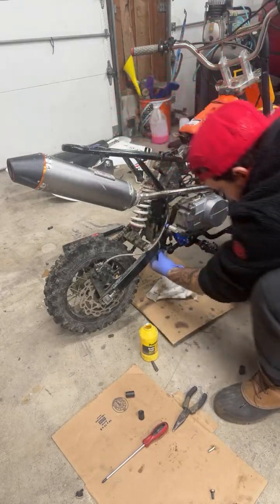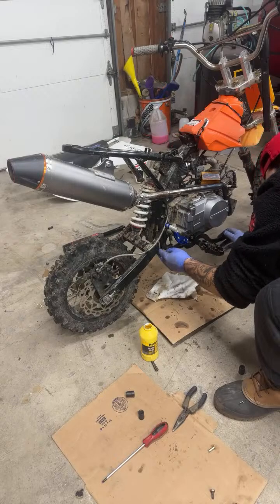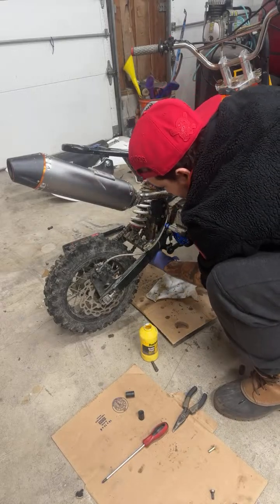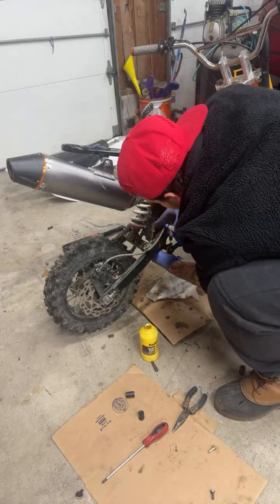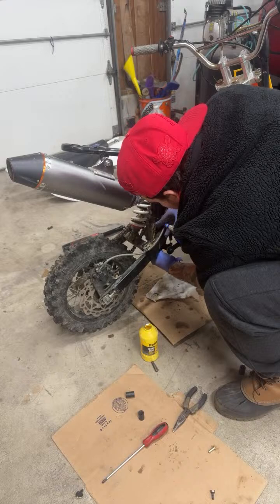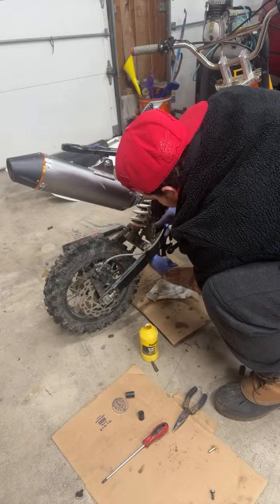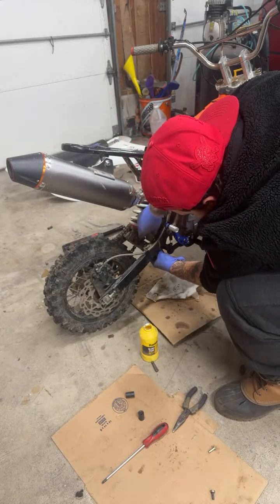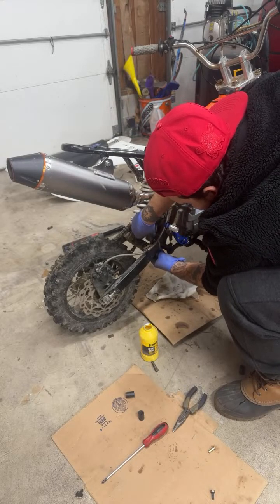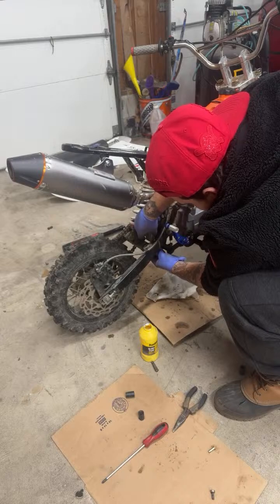But yeah, let's get this brake on. I adjusted the plunger. I think I adjusted it a little too much. Yep, definitely, because it just fell off. Let's tighten it, and then start pumping the brakes and bleeding it. So I just went in like 3 screws. I'm gonna bring down these nuts. One is to keep it in the position, and the other one's to lock it. So it's like, I want it right here. Okay, the other one, you're gonna lock it. So, boom.